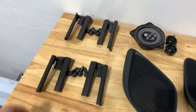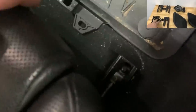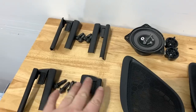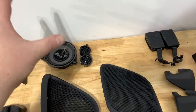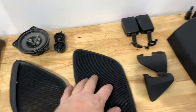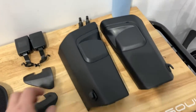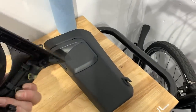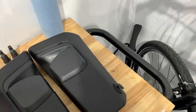What I've noticed is that there are two electrical plugs attached to this Porsche seat belt. There aren't any equivalents on the one I bought from eBay, which is probably why these cost $900 and the eBay one was $35. For the seats, you take the trim pieces off the ends of the rails to get to two screws, and the two screws at the back of the rail are visible — just on the front of each rail for each seat. You don't need to take out the speakers, just the screws. These are the seat belts from the rear seat with the little covers, and these are the tops of the B-pillars where the seat belts come out. You don't need to take the whole trim piece off — just pop this piece off: two clips on the bottom, two clips on the top, and a plug.